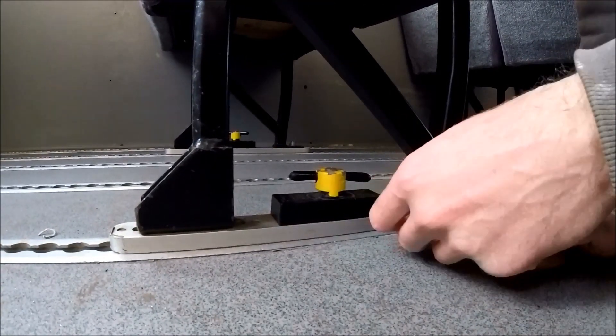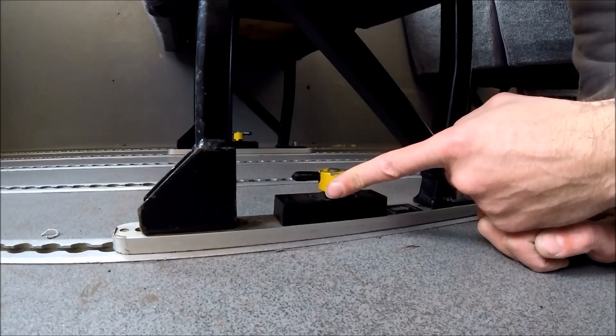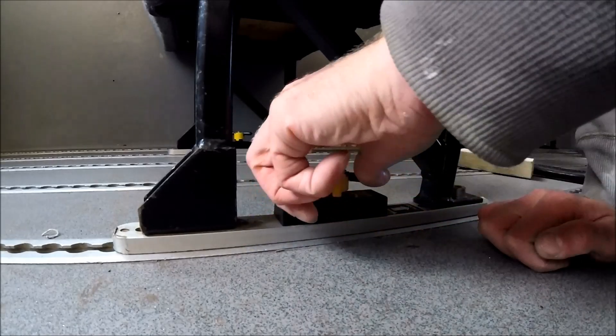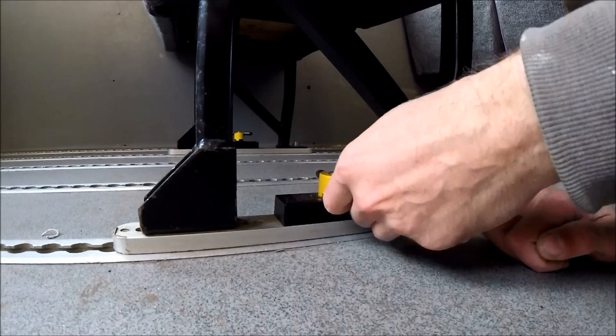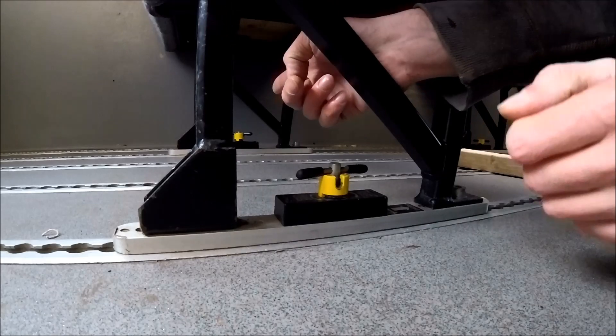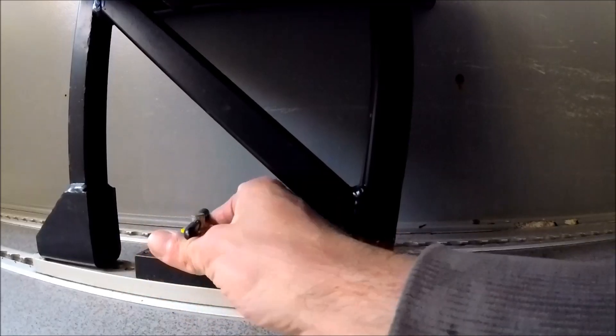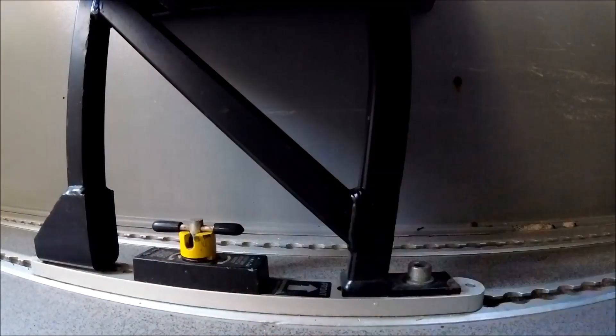On the quick release mechanisms, you just need to twist the yellow plunger lever down — that's the locking mechanism for the rails. That just needs twisting round, then lift the plunger up and twist that as well. Same on the other side, on the other rail over there. Twist it round to unlock, lift the plunger, twist that round. Now that is the seat actually unlocked.